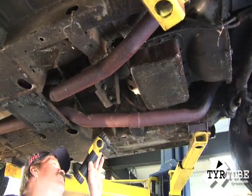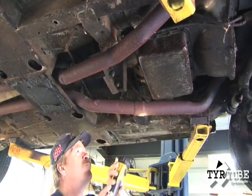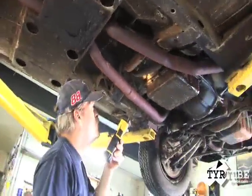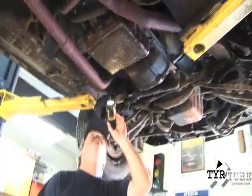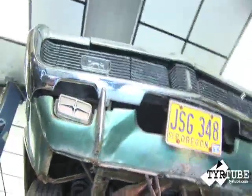The pan's leaking and the servo's leaking a little bit. That servo uses this vacuum port right here — it uses vacuum off the engine to shift the transmission from first to second to third. The linkage is leaking a little bit too.